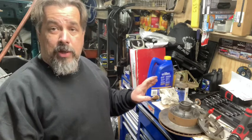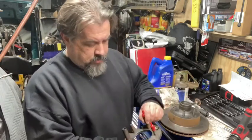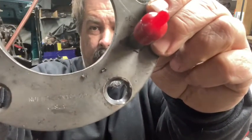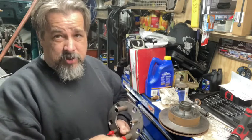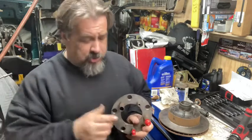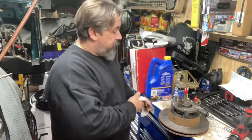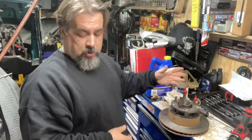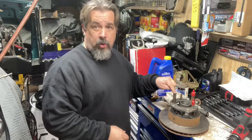I'll do a quick video and show you how I drilled it all out — I'm just going to speed it up, there's no sense wasting a bunch of time going over how to drill holes. It's pretty basic. This is the tool — Rutten Leonard is the guy's name. I bought this about five years ago and I'm assuming you can still buy this tool. So you drill a pilot hole quarter inch and then 19/32 — I believe it's still chucked up in the drill. Really simple. You put the tool on — obviously I've already changed the bolt pattern so I can't bolt it down to show you — you bolt it down using five lug nuts, drill your pilot hole, unbolt it, turn it, drill your next pilot hole, change your bit out, go ahead and drill your big hole. You just keep bolting, unbolting until you get all five of them done.